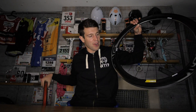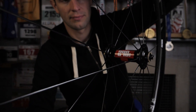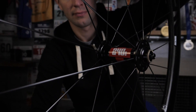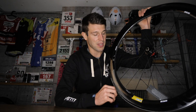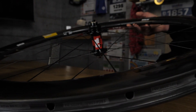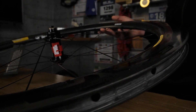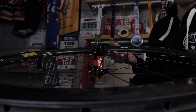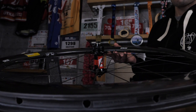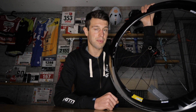How does the disc brake version differ? Actually quite a lot, surprisingly. It would be easy to assume it's more or less the same wheel just with the option of installing disc brakes, but these have really been designed and optimized for disc brake use. By eliminating the braking track it's opened up a whole realm of aerodynamic and structural possibilities — it's allowed them to change the rim profile to improve aerodynamics, shed some weight by not having to manage braking heat build-up, and it's also improved tubeless performance.